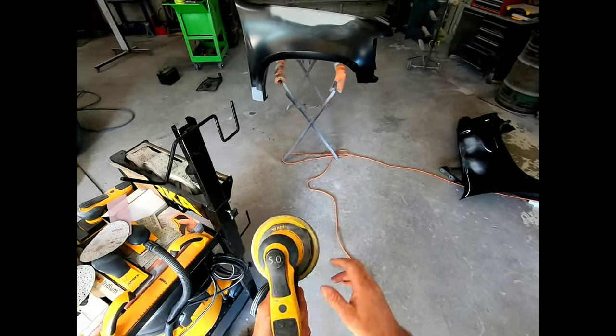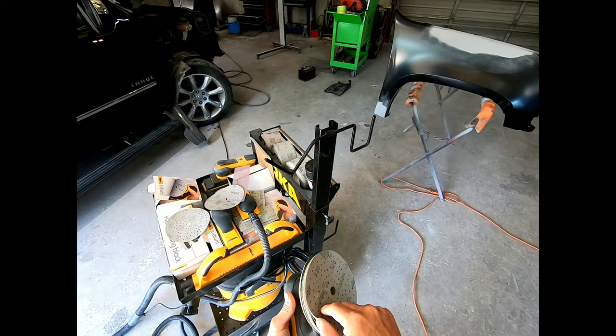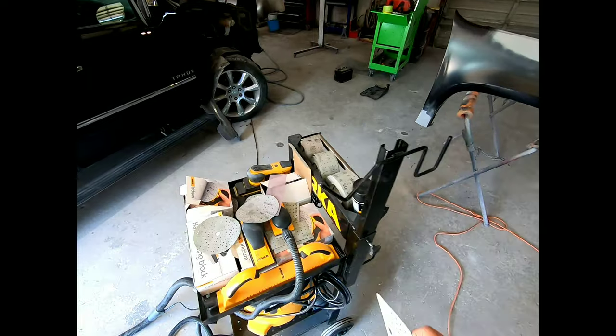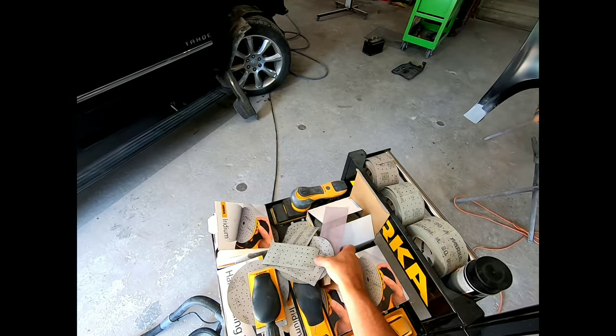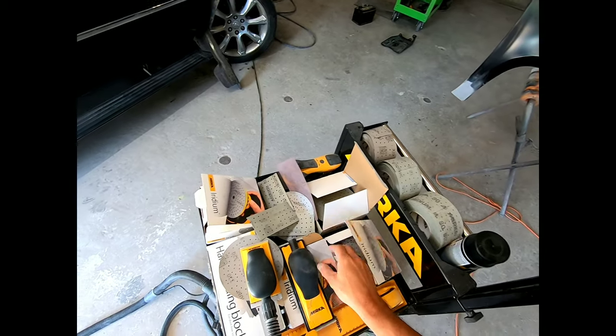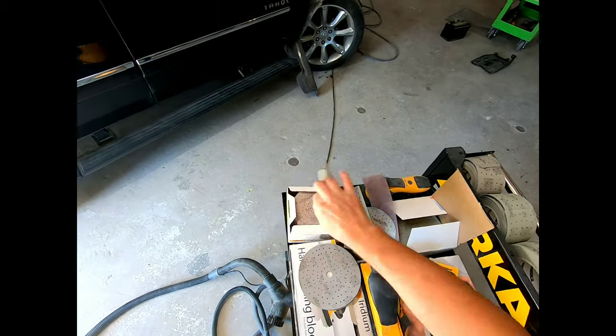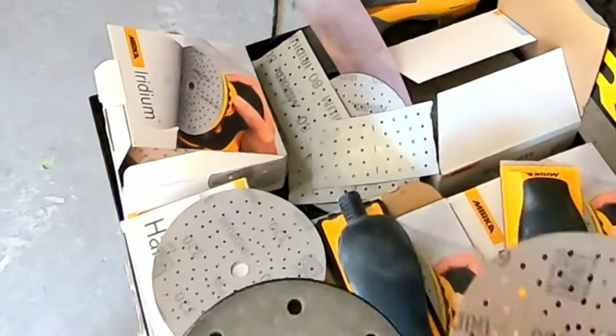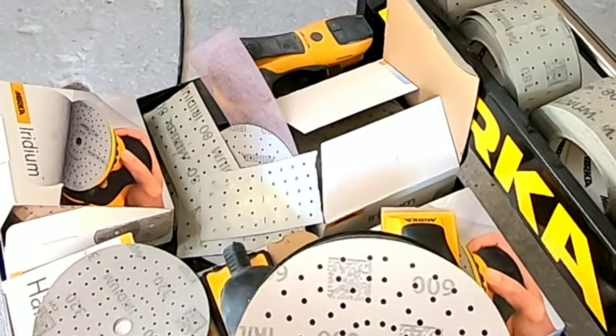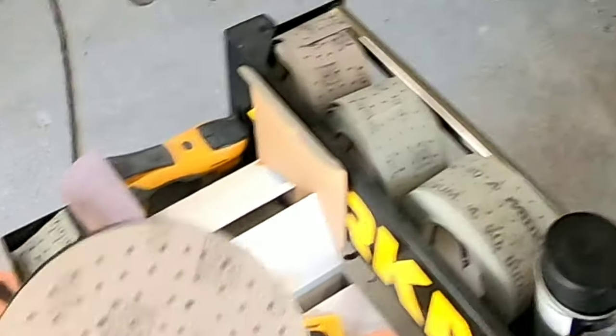If you're doing this at home, you need a piece of sandpaper. I would recommend a 320 grit sandpaper by hand. However, if it's a high metallic paint you're going to be painting, use a 600 grit instead. I'm going to use 600 grit here on my dual action sander.